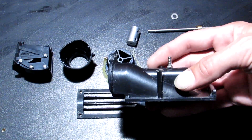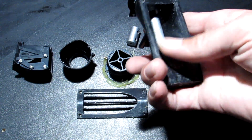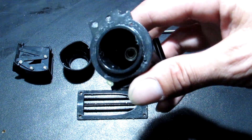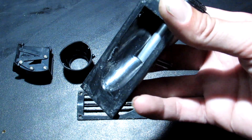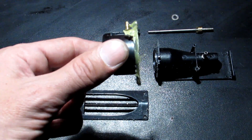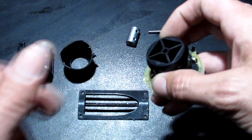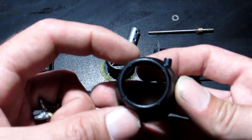Here's the housing - still in good shape. The only problem is bits of silicone on it. I tried alcohol; short of scrubbing with dish soap and a scrubber, try to remove all of that if you ever have to reinstall this, because it will prevent a good seal, especially with hot glue. This is the end cap that goes on the outside of the boat - it still has hot glue on it since I only wanted to temporarily seal it when retesting the new impeller fan that I'm going to show you.